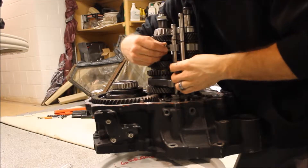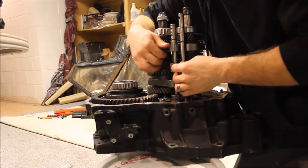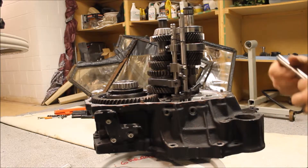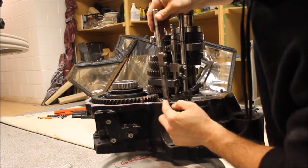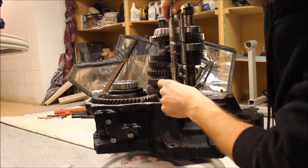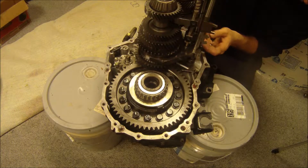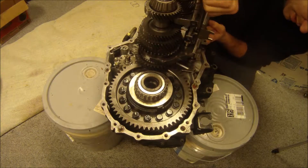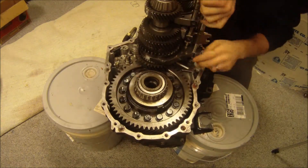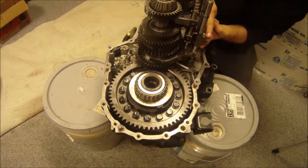Let me do it this way so you guys can see it. Pull it in the rest of the way later. Then there's this one — obviously you can see these go here, so this shaft's here, this shaft's here, and the top shaft's through the other part of the case. You can see this is going to line up with that. Now here's the interlock wall — here's the notch for it. I've got to pull this shaft up until that interlock connector goes over there. There we go — and these all line up.